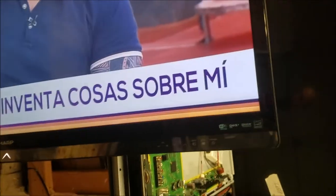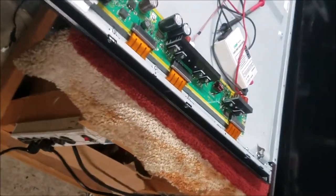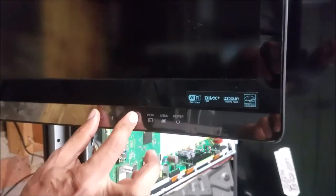If you don't unplug the TV, it's going to turn on and off fine. I'll turn it on — you can see the symbol is on and the TV turns on fine. Let's turn it off again. Turn on — yeah, turns off and on fine with no problem. But if I unplug it and wait a little bit to discharge, then plug it back, we get that error again. So we need to reset it again: Volume Down, Channel Up, Power.